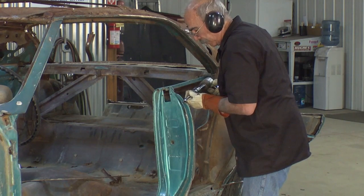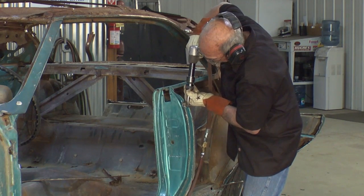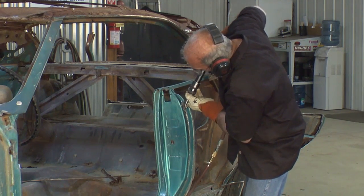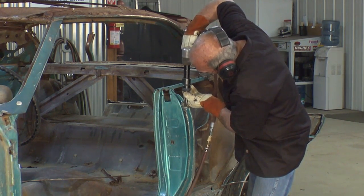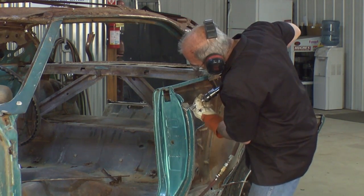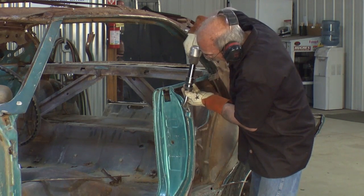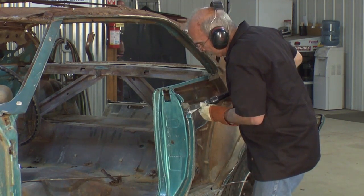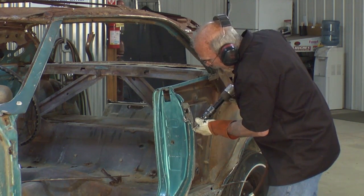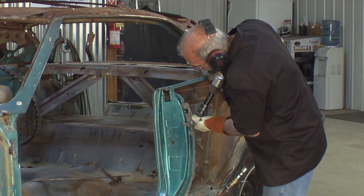Cut it right through right there — now that single plane is right in front of me. I'm not just ramming it down on a spot weld. I'm using the chisel to push it over the top of the spot weld. Using a couple different angles when I come to the spot weld — see the metal lift away right there. Getting behind it, lifting it out of the way — it's all giving me advantage to get over the top of the spot weld.